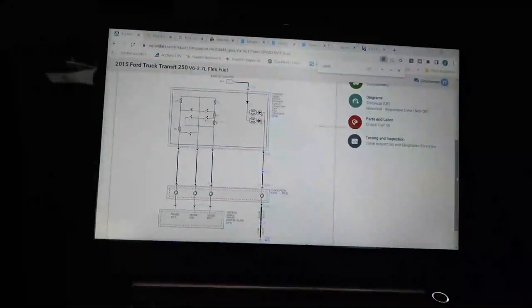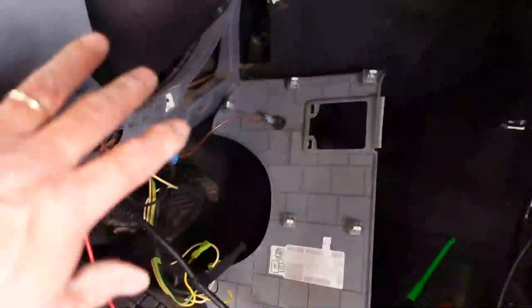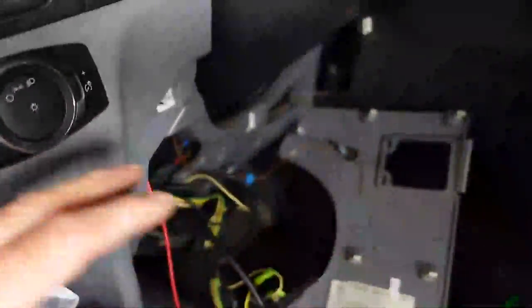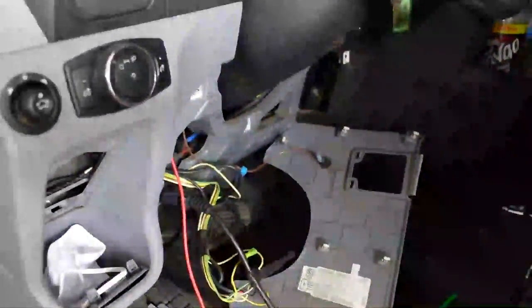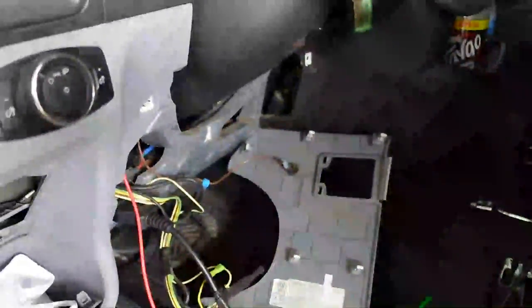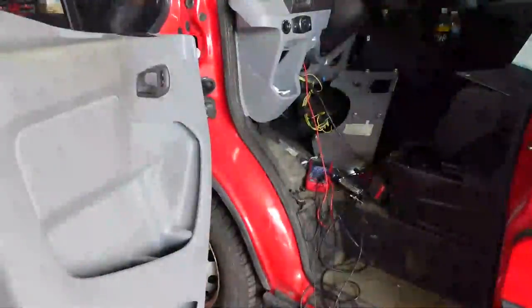And I'm at the point where we're gonna call a BCM on this. I'm gonna take my chances. I am gonna do a PMI with the new module already installed. So we're gonna install this. I'm gonna go ahead and install the new BCM, start a fresh session of IDS. I'll make sure we start a complete fresh session and there'll be no traces of the old information here to pull over.